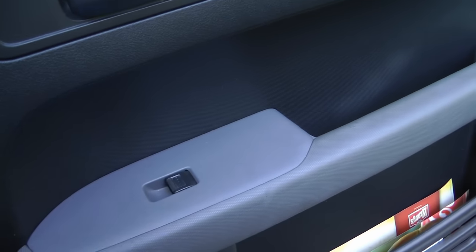You can hear stuff, so you know something's broken inside. If you didn't hear any noises, it could be a bad switch, or a fuse, or a relay. But in this case it's getting power — we just know something's broken inside, so we'll take the door apart.